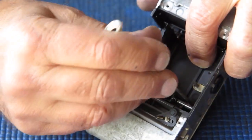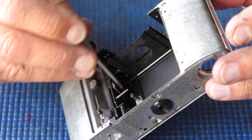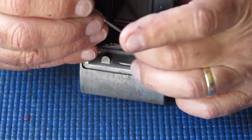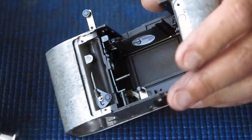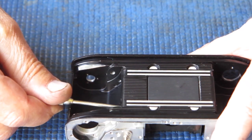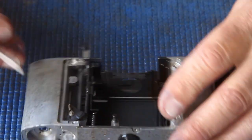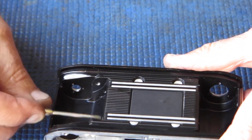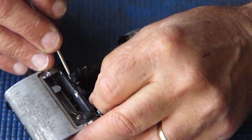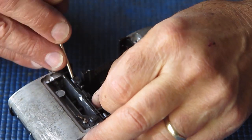I'll just bring up this bracket at the back here to hold that capping plate down while I'm fighting with this so that it's not too much of a fight. Now, am I in the right place here? Okay, so there's an arm here that needs to be forward of this thing, and at the moment it's behind it, so I've got to undo, take this front arm out again and get that correct. I'll slacken these two screws off slightly. Now I need more than that. That lever's on the wrong side, nothing will work. That's better.